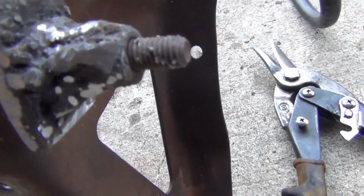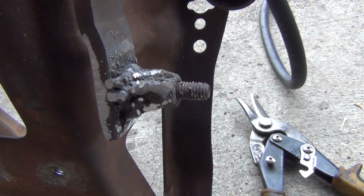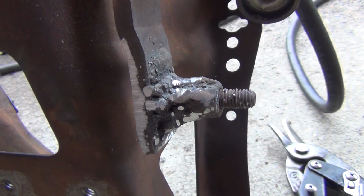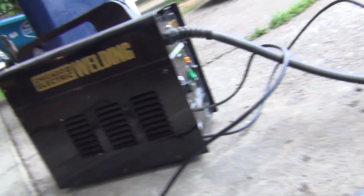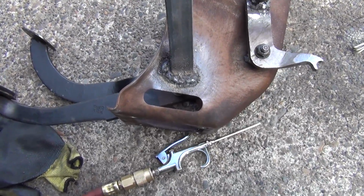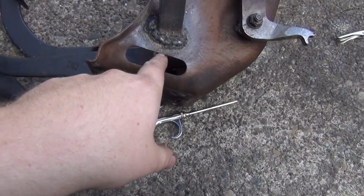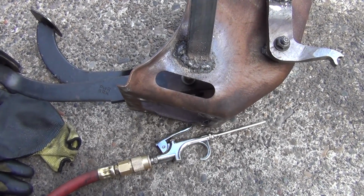Okay, so this bad boy here, it looks ugly as sin, but I don't think that's breaking. I went max heat and for the most part, I didn't see any cracking or anything else. Eventually I'll get it, part of it's this type of welder. Take a look at my horrific welds. I'm not even going to show you the other side. I kept going on this until I got this metal hot and then joined the two pools together. Tried to do that on this, so,